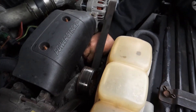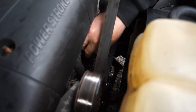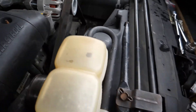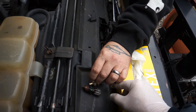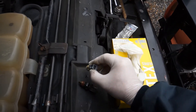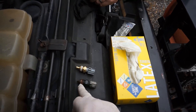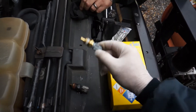Whatever drips out drips out down through the bottom, and you can see it leaking now. Now that we've released the pressure, I'm going to tighten the radiator cap back up so it holds in. You can see the old one versus the new one laid side by side — night and day difference, but they match up and the prongs are the same. You can see this one is just beat down. The pellet's a little longer on the newer style, but same thing from the Ford dealership.